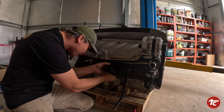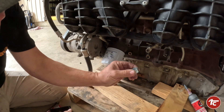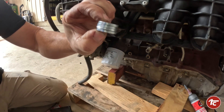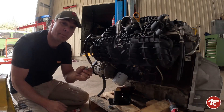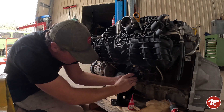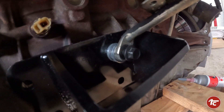On the right side of the engine we've got a little brace — we just need to make up a spacer of about 12 to 13mm, so we've used four nice big fat washers as our spacer. We're only going to cut 10mm off three of the bolts and keep one full length. If you chuck the spacer or washers on with the nut to hold it all in place, you can then slide the McKinnon's engine mount straight up onto it and bolt it in with no issues.